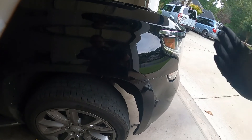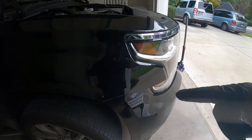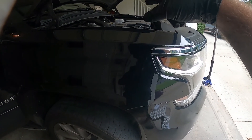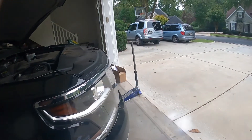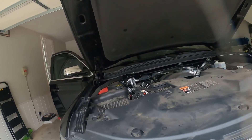Jack the vehicle up high enough so you can get the tire off. After that, once the 17s are taken out and the electrical connector is disconnected, you're going to have to pry down a little bit on that lower control arm in order to get the strut assembly out far enough to bypass it.